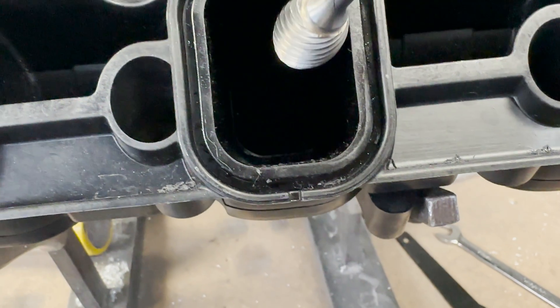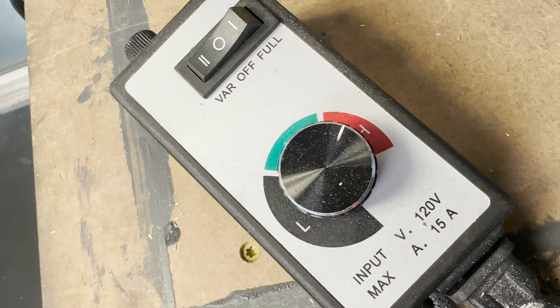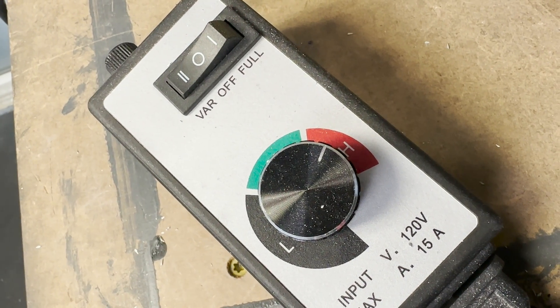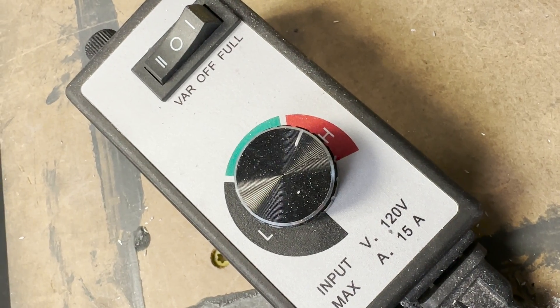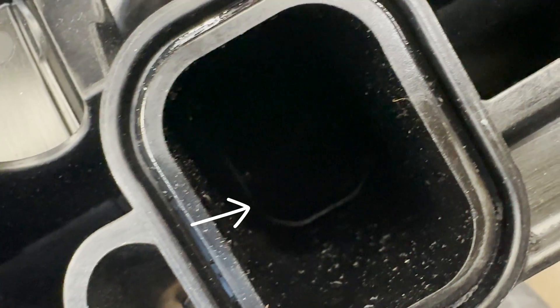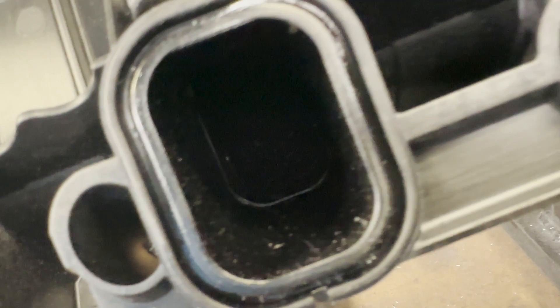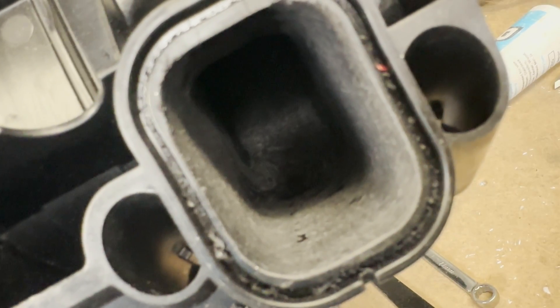For dimensions we are not coming up with these on our own — I asked Alex what size the head is and he gave us some dimensions, so I had something to go off of. I'm not just winging it; I'm going to an actual size. First up, we're going to take our Makita GD0603 grinder with the Head Games three-quarter burr and go at it. I'm using a Goodson speed controller — the grinder is good for 28,000 RPM and I'm using just about all of it for the initial cut.